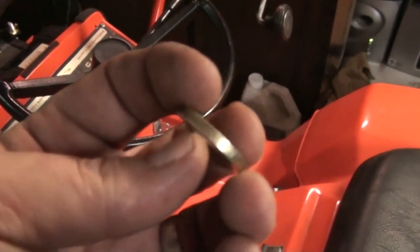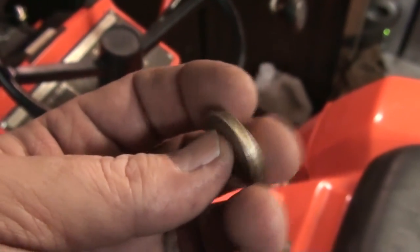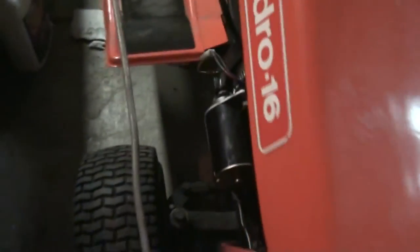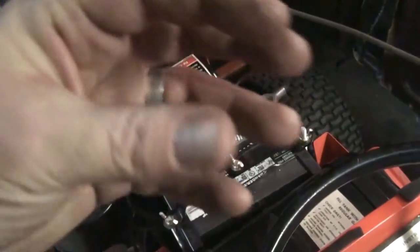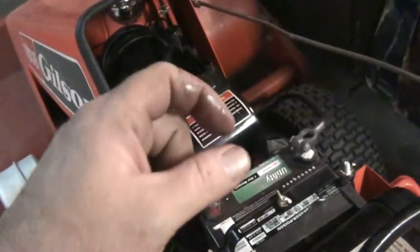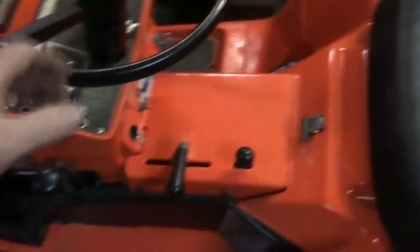So I had those washers in there and all that did was spin. It occurred to me that I could take the cover off and see what was going on. I thought the shroud was riveted but it turns out they're just quarter-inch nuts. I put the starter on without anything and it did seem to bind - as the starter gear was backing away, it would sometimes just bind and stop. So I found some washers about half as thick as the ones I just showed you and put those on there. I tried it once and it seemed to work better - let's see if it starts and how it handles.